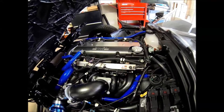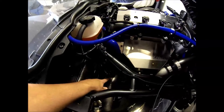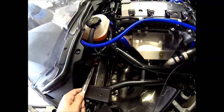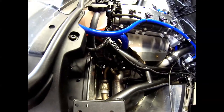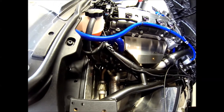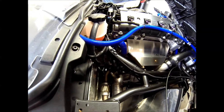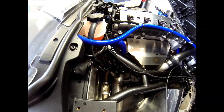It just plugs in — make sure you have a good connection, plug it in, and use a zip tie to clean it up so it looks good. You obviously need to make more boost or change your springs out so your wastegate will allow for more boost. This is where you need the 15/16s if you're running an air-to-fuel gauge — it works to take this out. Just set it over here so it's out of the way so you can pop the cap off the wastegate to change your springs. You can go to a red spring instead of a natural color spring — that'll be right around eight pounds of boost.